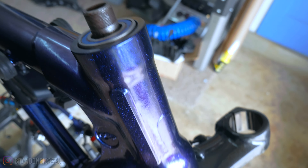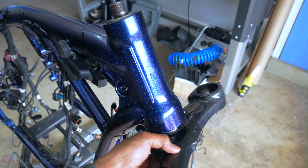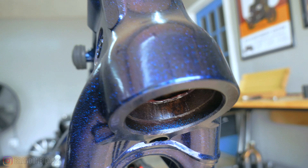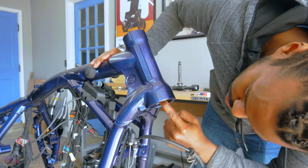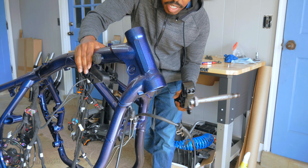The way the steering stem works: you've got the upper bearing right here that has already been replaced. The one that was in there had a little catch on one of the rolling bearings, so it needed to be changed out. The stem slots in like this and comes through the top when it's fully seated, and these little rollers allow it to turn. There's a little outer race right there that it sits on — I left the original one in because there are no nibs or catches on it, it rotates freely, and it's fully greased. Still a good piece, so there's no point in changing it out.